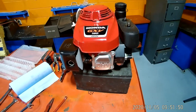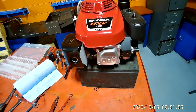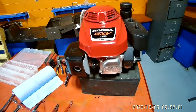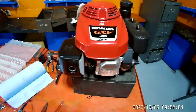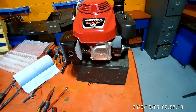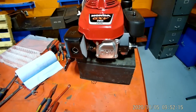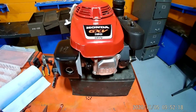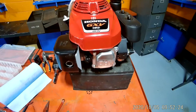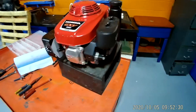Hello everyone, this is video number one in how to disassemble and reassemble the Honda GXV 160 OHV. Now this is a Honda, so everything on this should be metric. I doubt we're going to find any standard nuts or bolts. If you're using 9/16ths and half inch and stuff like that, you're probably using the wrong wrench or socket. You should be using 8, 10, 12, 14, 17, 19mm — I believe that's what's going to be holding this engine together.